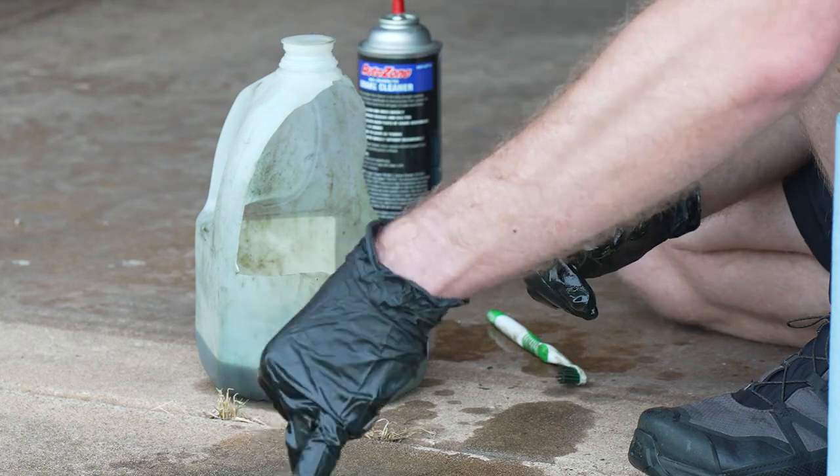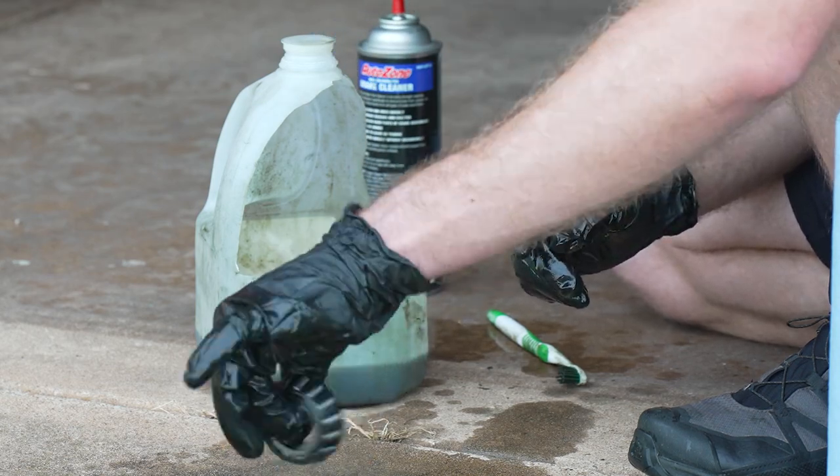When you're happy with the cleaning, we're ready to blast it down with brake cleaner. I'm definitely holding it on the inside so that everything is free to move, and we're going to try to get in between the bearing areas. That's probably going to blast most things out. You can spin it and blast it some — you don't want to use compressed air for this. Shake it out, make sure you don't drop it — we could ruin the whole thing.